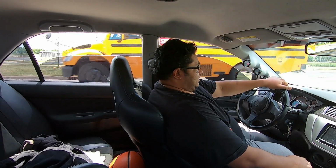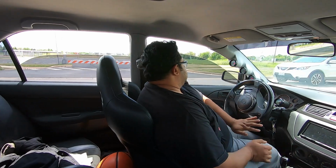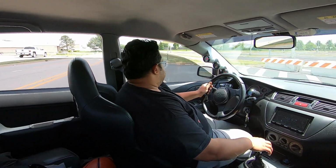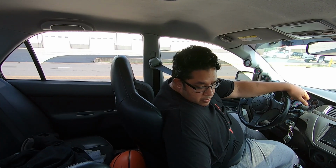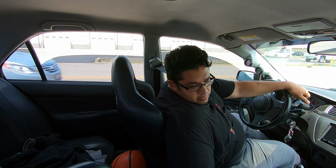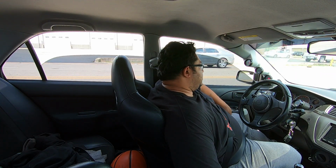But then again, this is not my car. I don't know what kind of ethanol he's gonna get later. There's a lot of factors. So I'm gonna make it a little bit rich. Just bring it down below 12. Yeah, the car feels good.